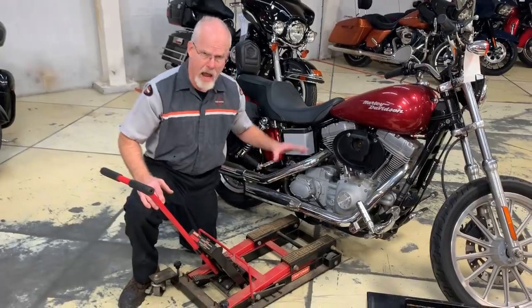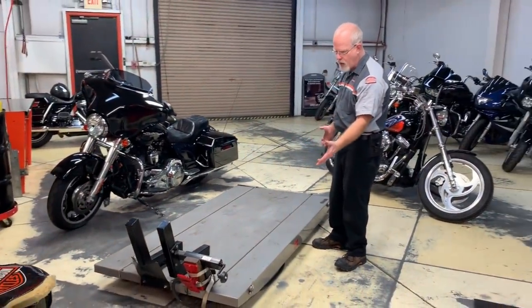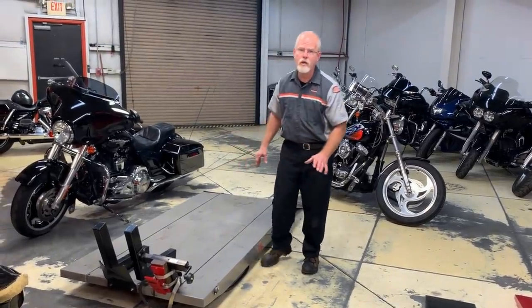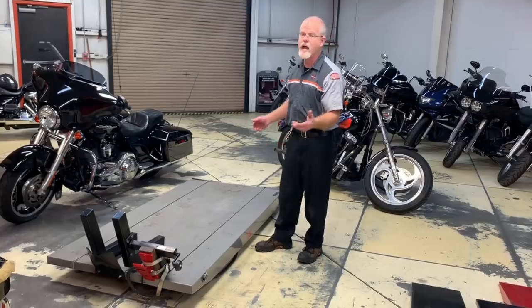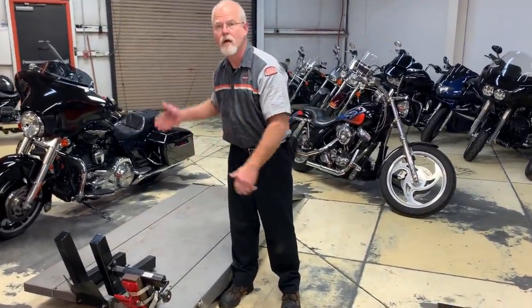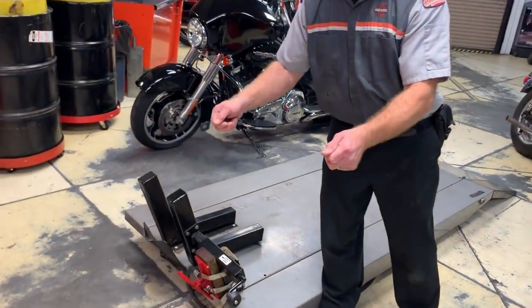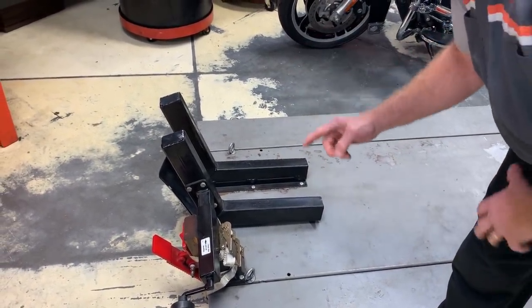At Low Country Harley-Davidson we use this type of lift — we love it, it works great, and it uses air to raise and lower it. You can also get this model with an electric motor if you don't have an air compressor, and I've seen a smaller version with a foot pump. These are built for a full-size Harley-Davidson. One great feature is a vise for squeezing the front or rear tire — sometimes we back a motorcycle in to service the front. If you have one of the new Breakouts with a 300-size tire, check that the vise opens wide enough, as many early models don't. Another feature is two eyelets to strap down your motorcycle — we strap to the front forks, not the handlebars, to hold it safely.